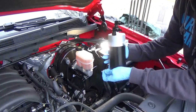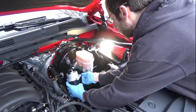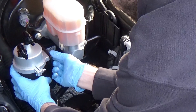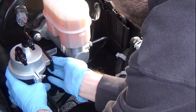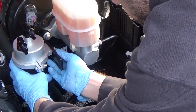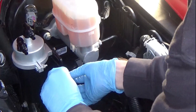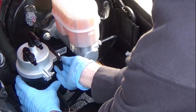Now we're moving on to mounting the catch can. Pick one of these slots — either top or bottom. I chose the top one. You're just going to thread these nuts — they have lock washers on them — and they are 11-millimeter, so hopefully that helps. I forgot to record footage of me tightening the bolts on the catch can itself and the bracket around it, but again they're all 11-millimeter, so just make sure after you get the catch can where you want it you torque all these down.